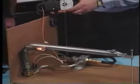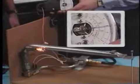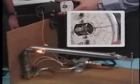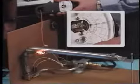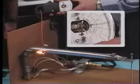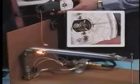As that igniter heats, the resistance of the igniter drops so that the amperage in the whole series circuit increases. And there it goes. So now it's dropping back down. It went up to about 3.1, I think, and it dropped back down. Right, it's normal for it to drop back just a little bit.